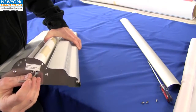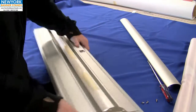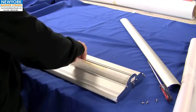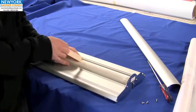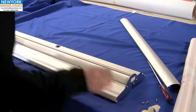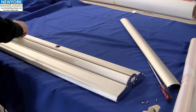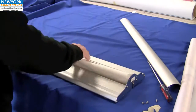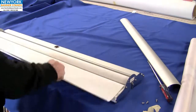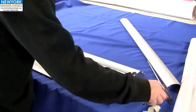and put it back in the smaller hole. You may need to rotate the drum a little bit so that the drum hole also shows up in the hole. So now it's locked in place. When you know it's locked in place, you're then able to take the tape off. And then unwrap it about a turn so that some of the leader is sticking out the front. It's still locked in place by the key.